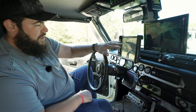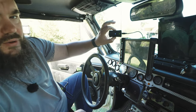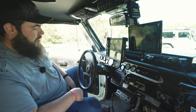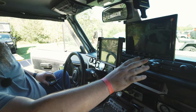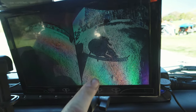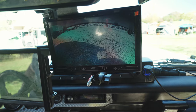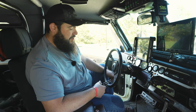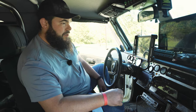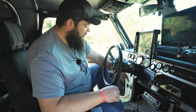Navigation wise, I use an Android tablet with Gaia on it — no cell service, I don't pay for cell on that. So I pair it with a Garmin GLO GPS receiver. They Bluetooth together and gives it a really good reading. I've got a put-together backup camera system — an approach camera up front and a backup camera in the rear, run through a multiplexer so I can choose which camera view I'm getting at any one time. Red Arc brake controller for the trailer — a nice upgrade because you can switch into manual mode; if you're descending a hill, actually activate your trailer brakes and have it hold you back. Then the gauge for the onboard air and the switch to control that.